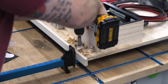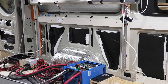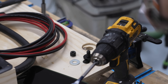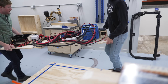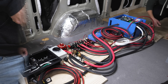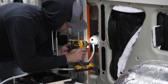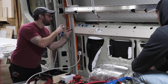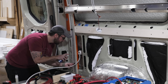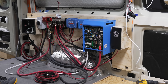With that done, we were ready to move all of the electrical components into the van, but first we needed to figure out how to mount the plywood. Thankfully, we had plenty of room on the L-track installed as part of the bed system in the last van video, so I drilled and countersunk some mounting holes in the plywood. We got the system moved from my workbench into the van — Nate and Ty handled the lifting since I'm still a little limited on lifting capacity because of my collarbone surgery. I got L-track studs installed and added a few drops of CA glue just to hold them in place while we lifted the panel. Finally, we could lift the panel into place and get the bolts added, and the panel felt super secure.